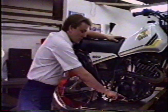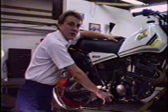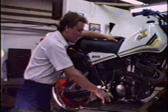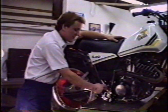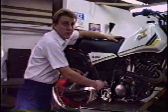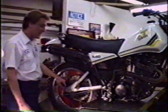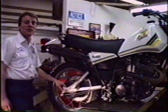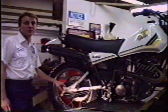Check your rear brake pads frequently. Also, I like my rear brake lever to go down about 2 inches before it'll lock that rear wheel. Always make sure to lock the rear wheel before you even think about pulling it up. Check routinely to make sure that your rear brake arm isn't going to hit your kickstarter, whatever might happen to be in the way on your particular model. More importantly, in the back, as your pads wear down, your rear brake cam arm is going to get close to your axle. Make sure it's not going to hit that axle before it locks the rear wheel up, or you're going to loop it.